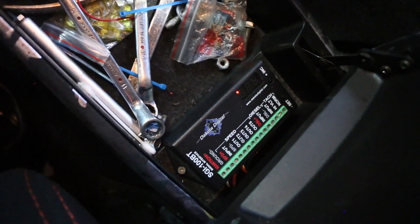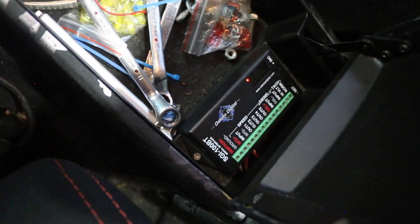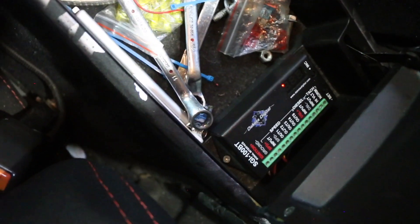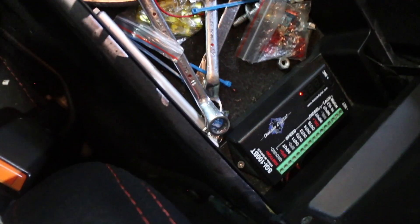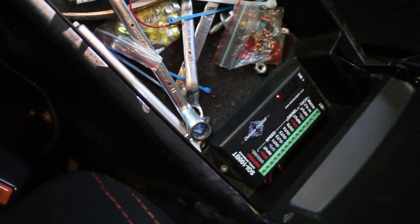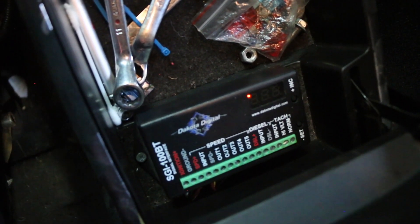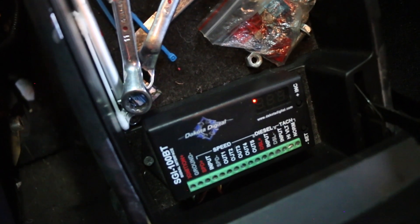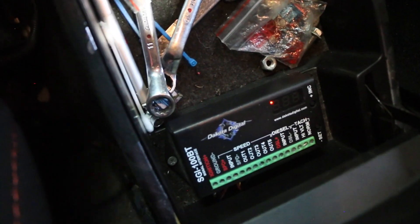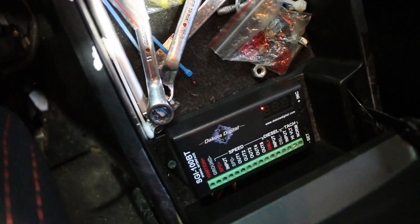Once you get your car started and verify everything is functioning, you'll see that red light — that red light means there is power and it is energized. When testing to see if it works, it's best to jack up the rear wheels of the car, chalk it, and put some jack stands under to keep the back wheels level. If you have everything wired correctly, that dot should start blinking when the car's rear wheels are in motion. Run it in first gear or put it in drive, let the wheels roll, and that red dot should start blinking.